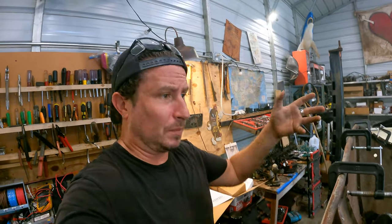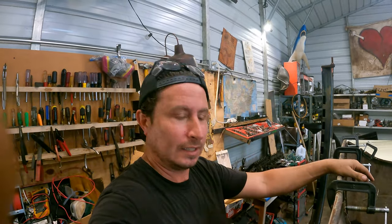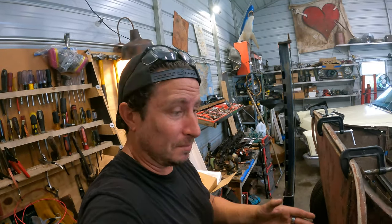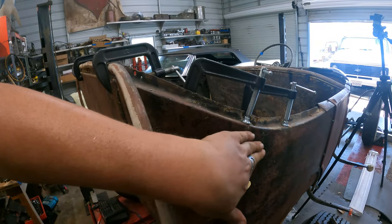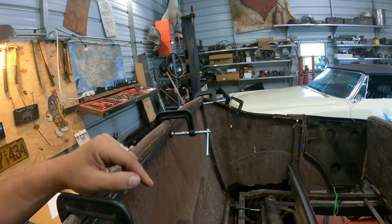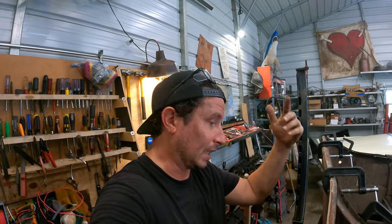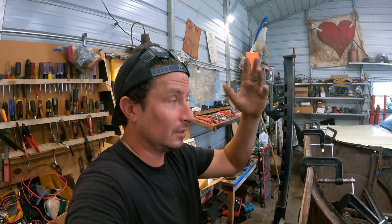So much less — that's just lining up the part that split back where it wanted to go. This car was built in a certain way, so it was under tension, and then it got hammered over the last nearly hundred years — the metal is functioning like a spring. If anybody's trying to put a junk body back together, keep an eye out for stuff like that. It'll not only get you closer to the original shape, but see how much flex that removes.